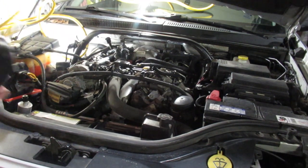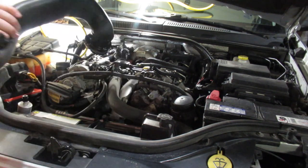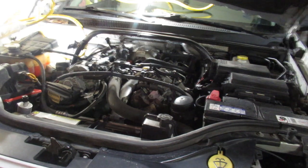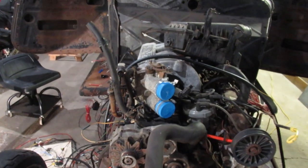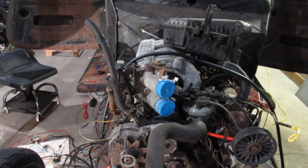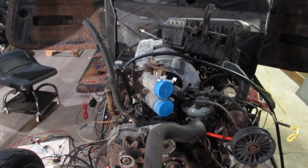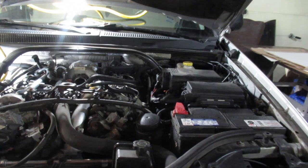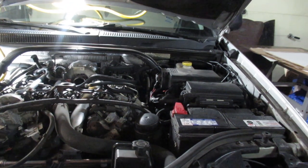We'll pull this hose out of the way. You won't really be able to see the inside of the tube here, but you should take a look inside on both ends and verify there's no evidence of dusting. I'm going to bag each end of that tube and then put a towel over the turbo. My preference would be to put plumbing fittings over the intake — that way if you put a cloth on the turbo and start the vehicle, it won't get sucked in and destroy your turbo. Do what we can to protect it.